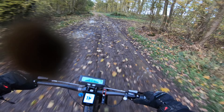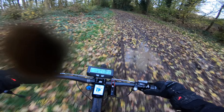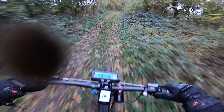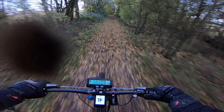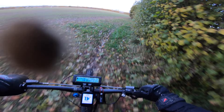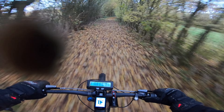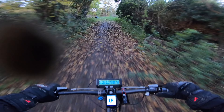I'm going back up this way — this is absolutely sodden over here. Good job I didn't clean it. These Bafang motors — with a mid drive, normally the controller is in the actual motor itself, so if you get water in the motor you're screwed. But because I haven't got the controller in the actual motor, my controller's waterproof to an extent. Because it's pretty much all sealed, and the only thing in the motor is the windings which are varnished, impregnated probably — there's not really any other wires in there, no hall sensors or anything. So if water does get in there, it may corrode some bearings, but it's not going to cause major problems. That's another good advantage of having an external controller.